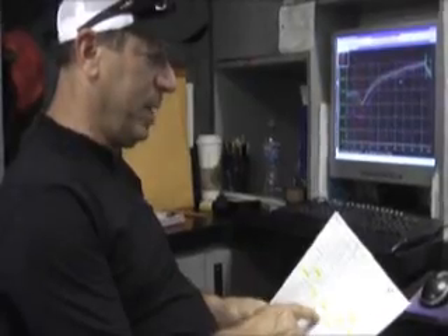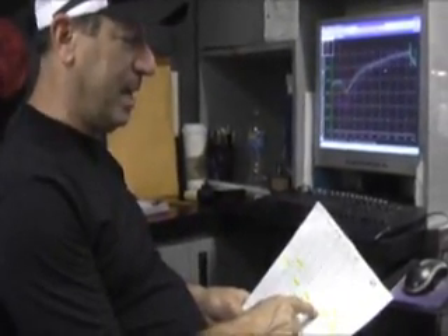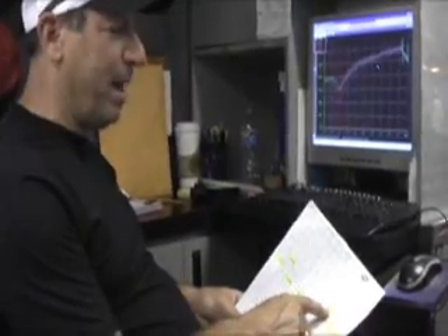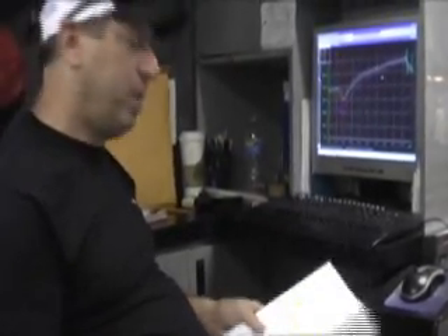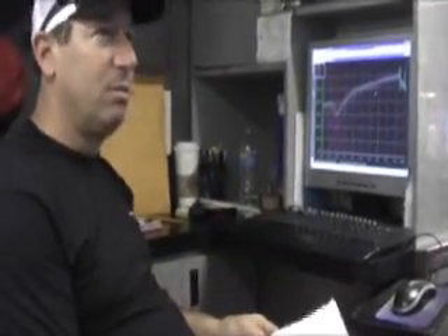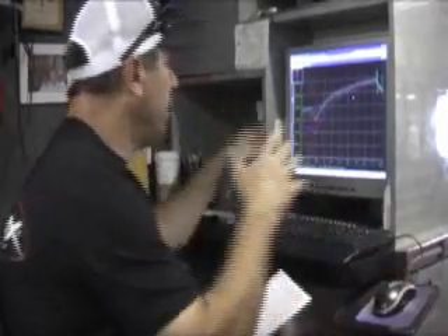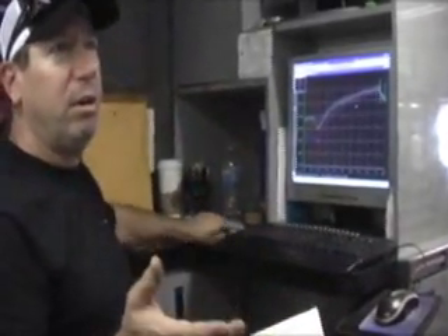Then as we get down track, you can see it starts to come back up. The transition signs are going back up the page. So you compare this with that — why did it do this, what caused it to do that? And you try and use the computer data, just like tuning a late model car. You've got all the computer data, but you've got to have a complaint, and then you correlate the complaint to what the computer tells you, and then you try to fix the problem.